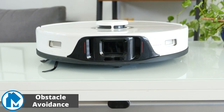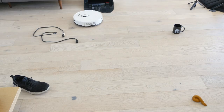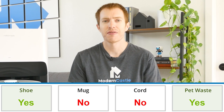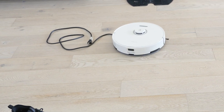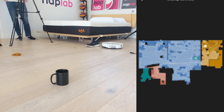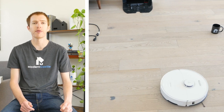The Roborock S8 Pro Ultra comes equipped with an RGB camera, LiDAR, and infrared sensors. It utilizes these together in what they call reactive 3D obstacle avoidance to avoid common objects found around the household. To put that to the test, we placed four objects on the floor and had the robot clean the area. While the S8 Pro was able to avoid most objects, it failed to avoid the mug and cord. In both cases, the robot seemed to attempt avoidance initially, only to fail and have the side of the robot touch the object. It never fully barreled into them, but it was enough to warrant concern, especially with the cord. After testing, we checked the map on the app — it showed the S8 did recognize the cord and mug and marked them, but just failed to avoid them completely. This recognition and the initial avoidance attempts give hope that these issues could be resolved with future software updates.